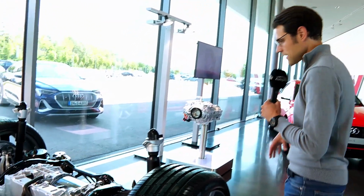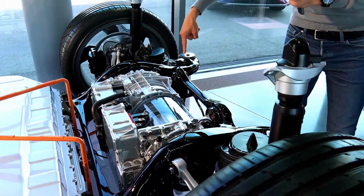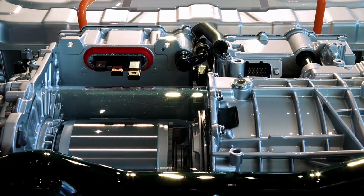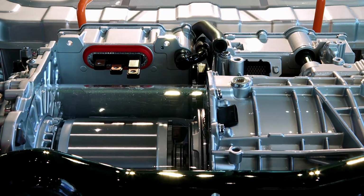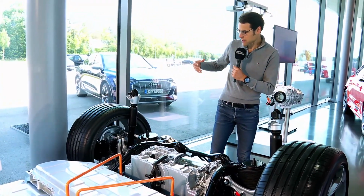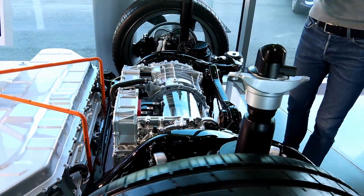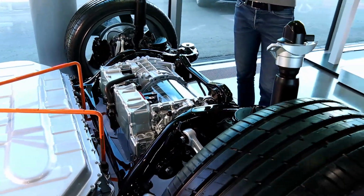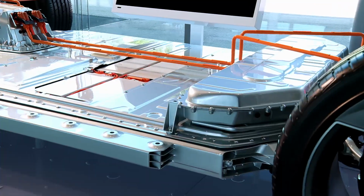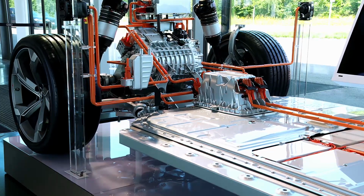And then here the rear, this is the new thing for the S model. 1 and 2, so there's like one casing together. This one here has a special cutaway, with plexiglass. There are 2 electric motors, one for this wheel and one for this wheel. We can imagine we're in a corner, and then this wheel can turn faster than the other one when we're, for example, turning left. It was also possible before, but just by brake intervention. Here it's done actively by speeding up the other wheel, and this gives this addition of dynamic.